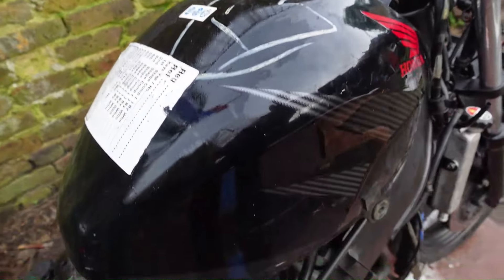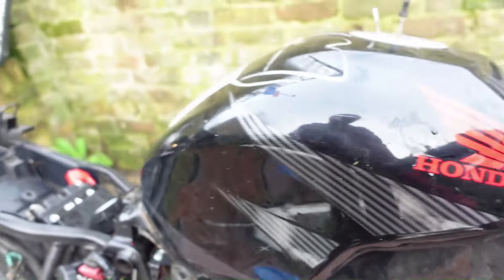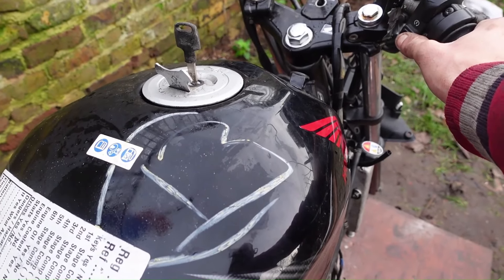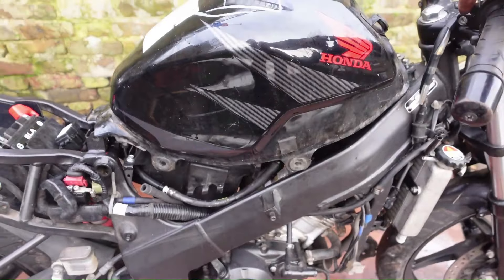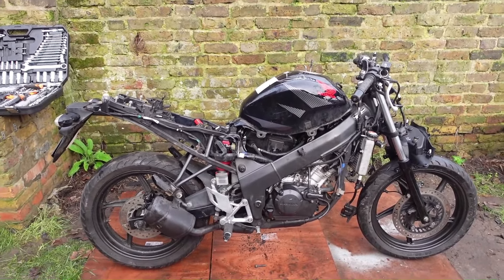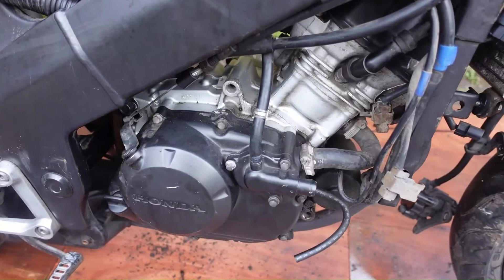Let's just see if it will spin over. It sounds good, but it will take a bit of time for petrol to come through, so I'm going to turn the bike on and off a few times like you would with an internet router. I think it's going to go now — turning the throttle off and trying again — boom. The trick was to have about quarter throttle to let some petrol in, then go to zero, and it's running. It sounds perfect.